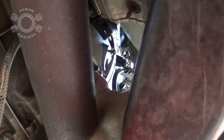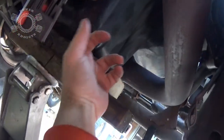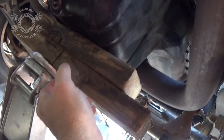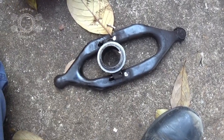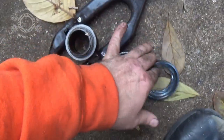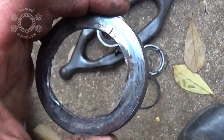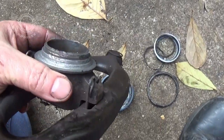Here's the scenario: we've got two bolts in the front, bell housing's got one up here, and that's what's holding the transmission in place at the moment. Transmission jack is back in place, strapped around it on the adapter plate. Keep a jack under your oil pan to support the engine, because once you pull all that loose the engine's going to want to drop back. Take these two bolts out, pull the transmission back — ladies and gentlemen, here is the reason we are pulling it. There's the throw-out bearing. Think we can salvage it? Me neither.